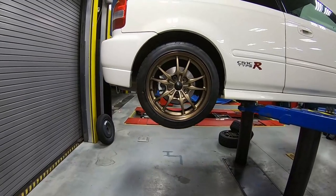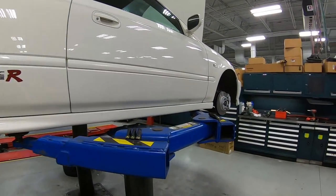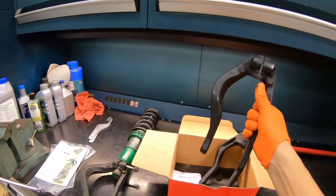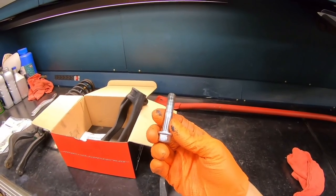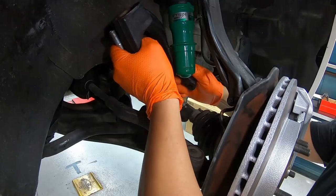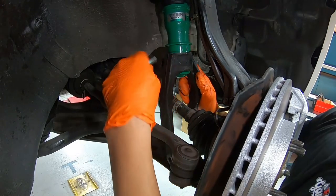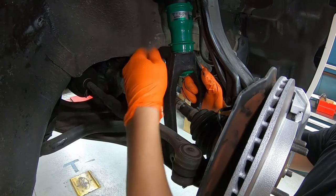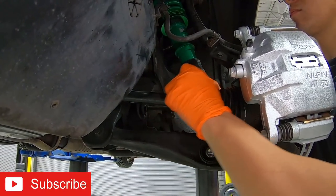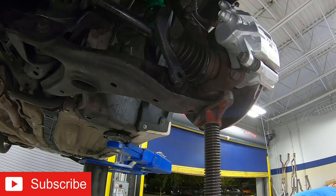So the rear suspension all good to go. We put the wheels on with two lug nuts, so that when we bring the car down, we can kind of see where the car is sitting. It's perfect timing because our guys have brought us the correct suspension fork for the front, and now we can go ahead and get everything done at the same time. And we got new bolts for it too. It'll be perfect. So all we have left over is to preload the suspension and tighten everything up.